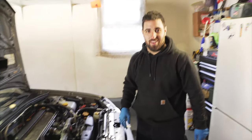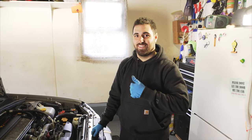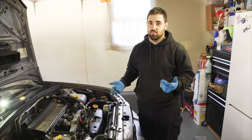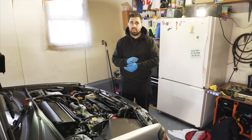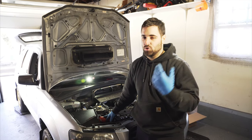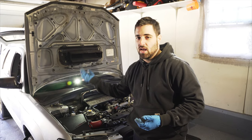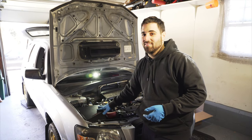And we're done — less than 30 minutes! There you have it: your intake's installed and it only took about 15 minutes. Now that you have an aftermarket intake on your car, you need a tune. You can solve that with a Cobb Accessport stage one tune or you can get a pro tune. My car currently has a Cobb stage one tune and it's perfectly fine for just the intake. But if you have more mods done to it, I highly recommend getting a pro tune regardless. The awesome thing about this intake is it's a short ram but performs like a cold air — it sucks up all the cold air without having to be down in the fender, so the chances of being hydrolocked or sucking up water are slim to none. You also get a lot of cool spooling sounds. Massive thank you to Grimspeed for sending over the intake for me to install on my Forester and to show you guys how to install it.